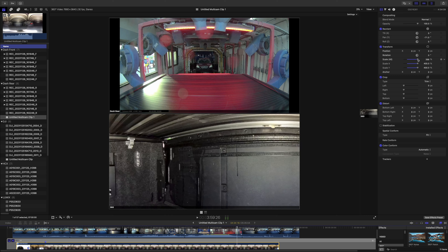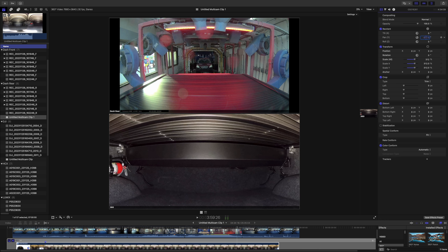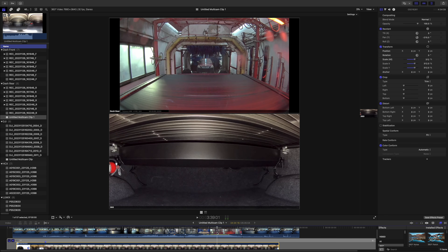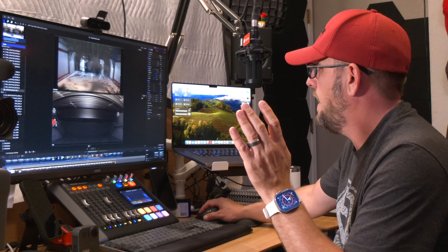What I'm looking for with these water tests is along the side rails, which tend to do fairly well. This is an area I also take a look at — if there was any water coming through here, you'd see some suds coming through or dropping down the front end. That seems to be a very solid result as well. Right behind that massive water dump you can see the air blowing off, and that's usually what will drive some water in if there are any weak spots. I just don't see anything there. This thing seemed to be a really solid installation, so I'm not surprised by these great results.